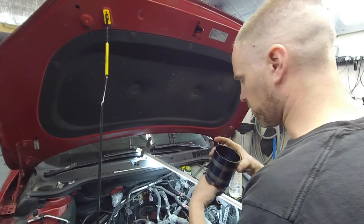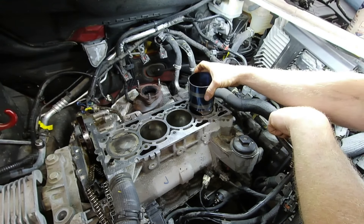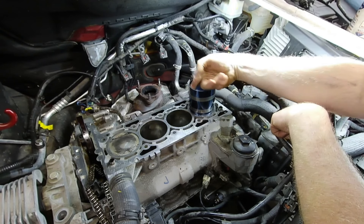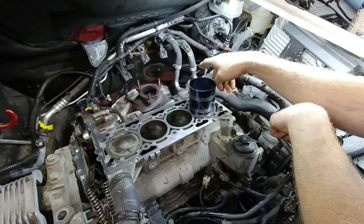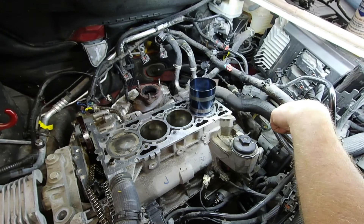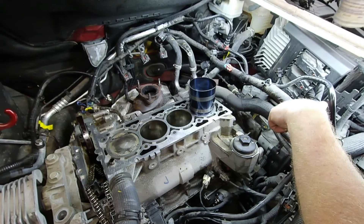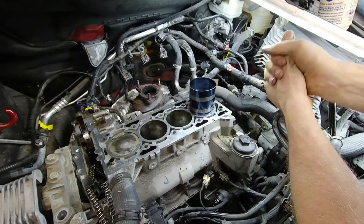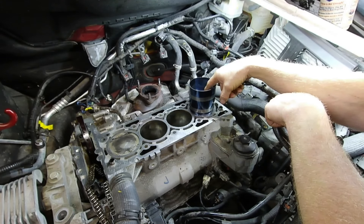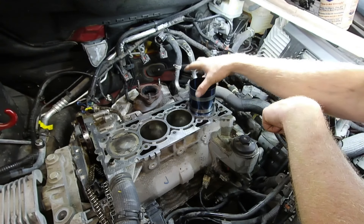I also wiped the inside of the cylinder with my special concoction of assembly oil — there is Lucas Stabilizer in it, but it's not strictly Lucas Stabilizer. I wipe oil in there so that when I tighten it down on the rings, all the rings will pull that oil into the cylinder, and it will be lubricated before starting.